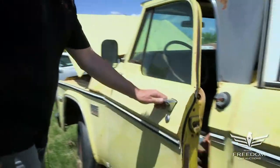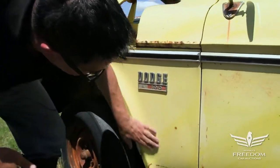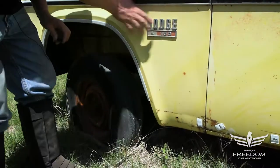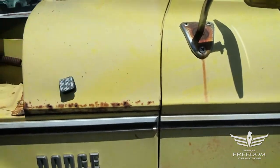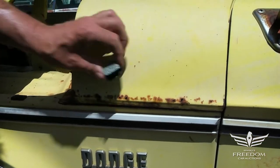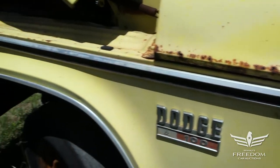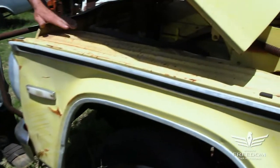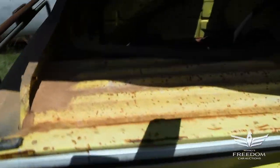Moving up ahead, the fenders are very, very nice — I don't see any rust here, and again, this is the original paint. There's a little bit of bubbling right here on the cowl top, but it is metal; these bubbles are honest, they're real, no effort to fill that. That's good news — I'd rather see that than an inch of Bondo. Inner fenders are wonderful under the hood, very nice. This area is often full of holes and rust.